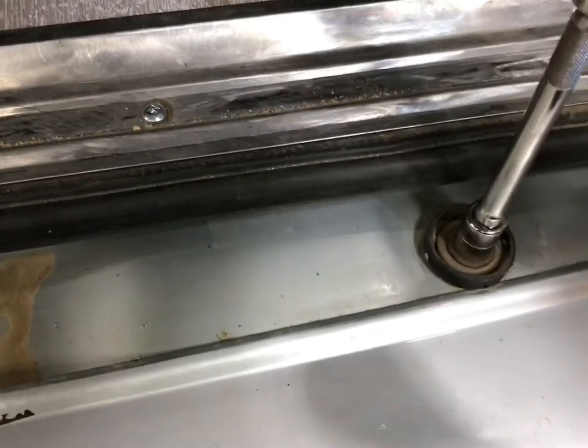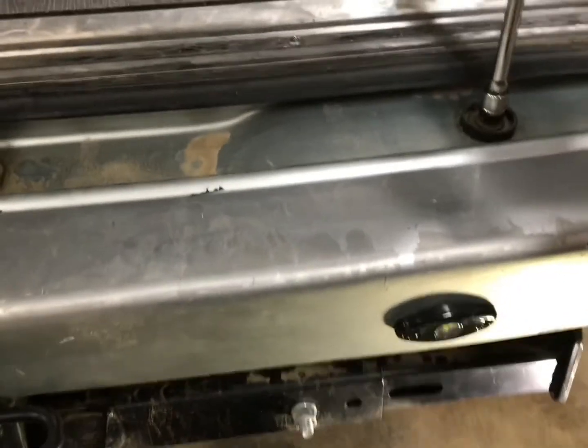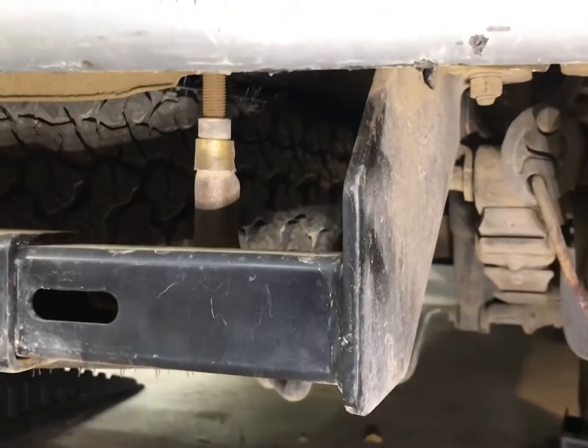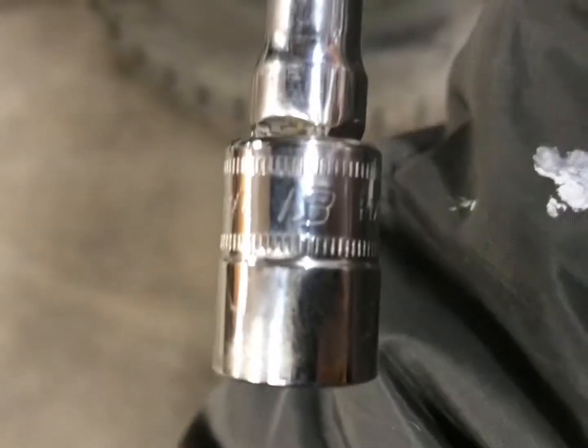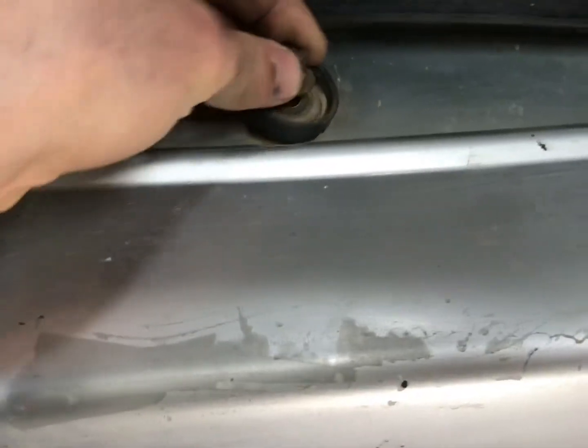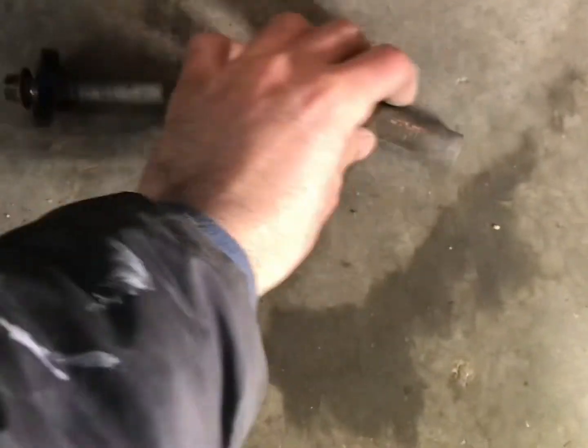Here's how I remove the fuel tank from my 91 Hiace LH119. Start by dropping the spare tire — it takes a 13 millimeter socket; the 12-point fits on that little square head bolt. There's a collar that goes with it. I'm going to put this aside and save it, even though I might not be reusing it.